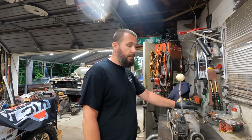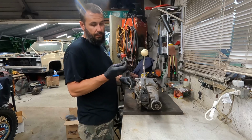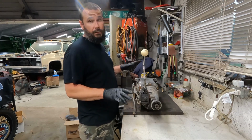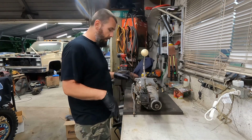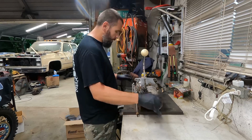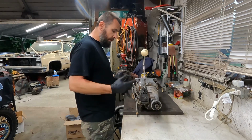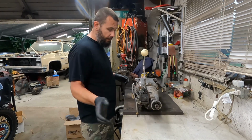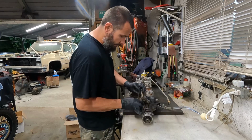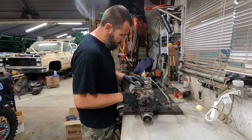And I guess I get to cut a new hole in my new floor. I bought a new, yes, I cheaped out. I actually bought bushings. I did not make them this time. Most of the lathes have been tied up, so I also needed all the clips. For like $13, just roll with it, you know. So I'm gonna take this shifter off, lay it aside, and pull the side cover. Pull the shifter. I'll also show you how to adjust these things.